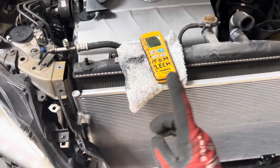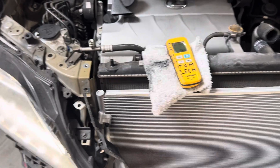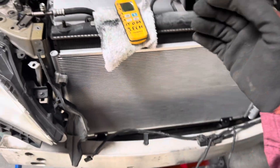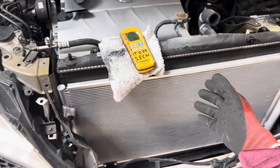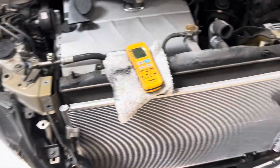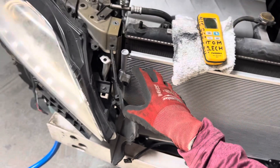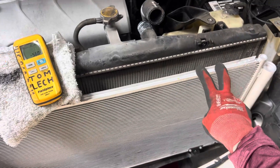It went right down to 200 microns really fast, then 500 microns really fast, and eventually to 84 microns — because nobody left lines off and exposed the system to air. When I did the refrigerant recovery, my recovery machine goes down to 800-860 grams. I back-purged with nitrogen before he disconnected, so air and moisture didn't get in. He immediately put it back on while I was working on another car, hit it on the vacuum pump — boom, done that fast.